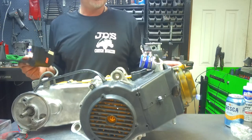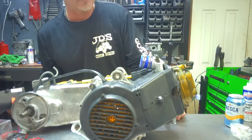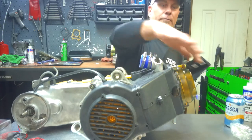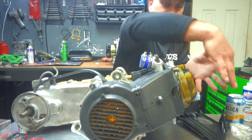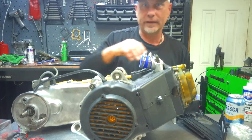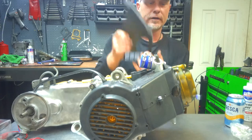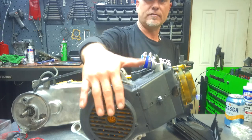You've got to remember, even in a scooter these motors have shrouds all around them. They had to come up with an air system where the motor is all covered up and can still — without being liquid cooled — grab air. That's why they developed these shrouds. On a scooter, the seat is above the motor and it's not able to grab air anywhere except from underneath. What the shroud does is allow air to suck in through here, pass around the head, and get sucked in by the fan.